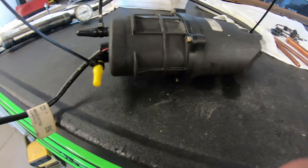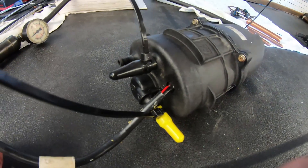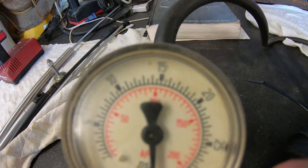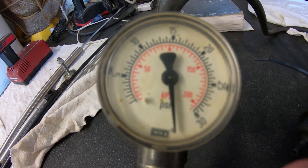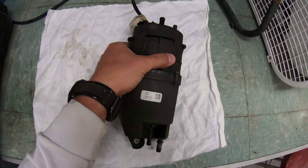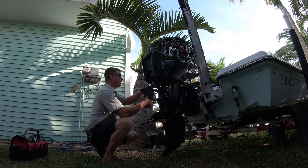Using some rubber covers, zip tie them onto the fuel outlet ports and install a pressure pump that can get up to at least 40 psi. If you can get 45 psi that is better, because the fuel pressure gets above this. If it will hold that 45 psi, I haven't seen one leak after installing it that did. And that's it — we've finished fixing the newer style FSM. Now just install it back onto the engine and we're done.